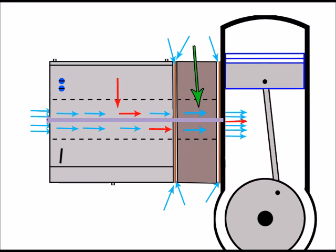Now, up until this point, the fuel-air mixture was correct because of the metered amount of fuel going into the air. And that was correct for engine combustion. But what we've got now is too much air coming into the engine compared to fuel, so it's a weak fuel mixture. And adjusting these mixture screws here to add more fuel won't compensate for this problem. Because the engine's receiving an air-to-fuel ratio that's weak in fuel, there won't be enough fuel to support the amount of combustion for a high revving engine. So this is when bog down is likely to occur.